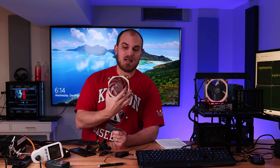So what does that give us? Well, you could say that there's no benefit to smoothing out a print, at least when it comes to thermals on this fan design for this test. But I would say that there is some performance to be gained, because remember, it might be cooling the same as the non-smooth print, but from our noise test, we do know that it's doing so while being quieter. And we all know that being quiet is a big thing in PC fans. So I think that because the fan is quieter and it cools the same as this one, it is a win for the smooth print. And everybody that said that if you smooth the prints out, you'll get more performance, you're right. You won't get more thermal performance, but you'll get a quieter fan, which turns into better performance.